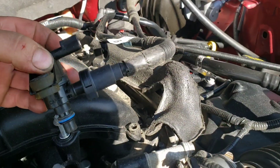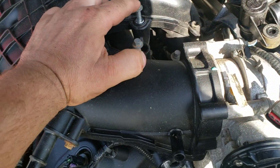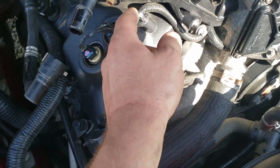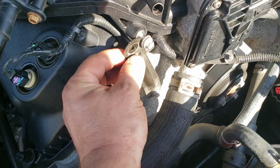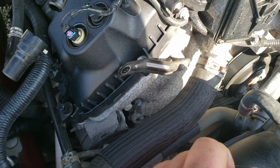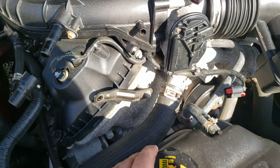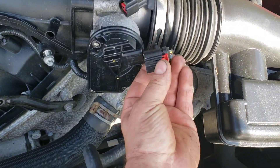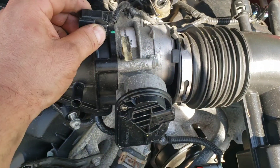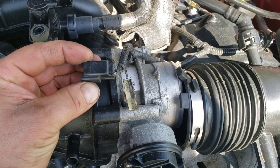This right here you don't have to unplug — I just unbolted it. Make sure no debris falls down in there. I always put my bolts back where they came out so I know where they go and I don't lose them. Disconnect this bracket here. Over here you've got to pull the red tab back and then press down on the black to pull it out. On this one you just press the black tab and pull it out.